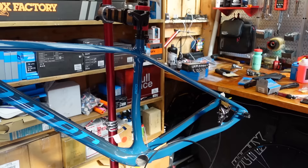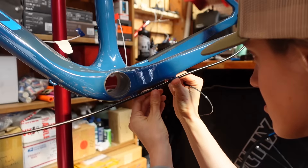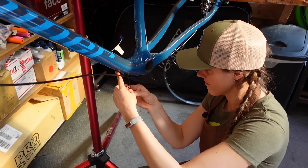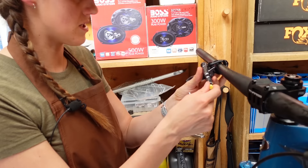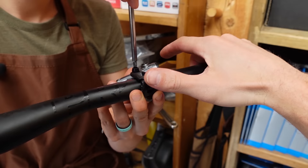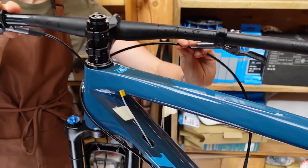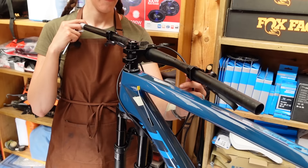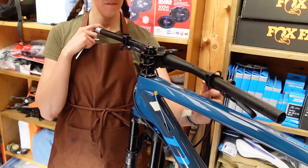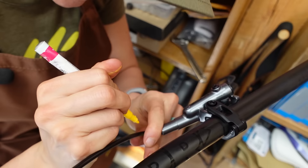We might as well go ahead and zip tie this because that would save us a lot of estimating. There are some benefits to external routing — it's definitely easy. Internal definitely looks nicer, but. Put your hand on here and give me a rough estimate compared to the other side. We could slide it out a little bit just to give it some extra. We need to test this — like this is going to be way too tight. And like way too much stuff — you don't want that either. And one thing: when you're marking it, give it an extra centimeter or so because it actually goes into the lever more than you think it does.